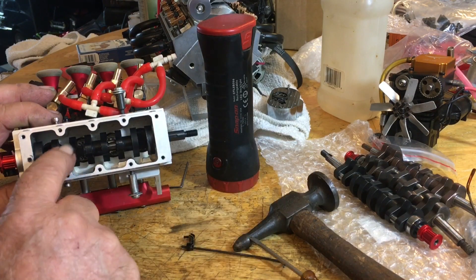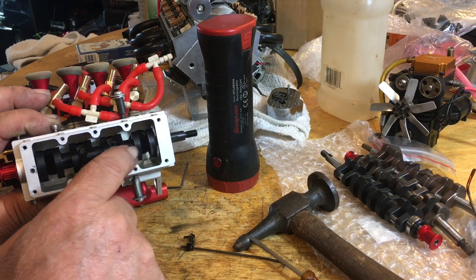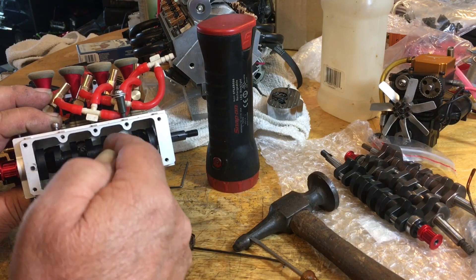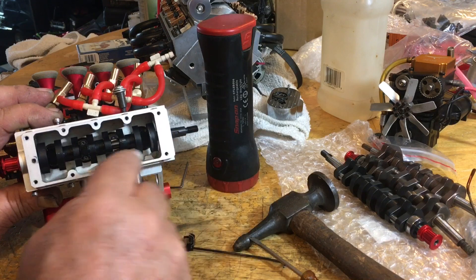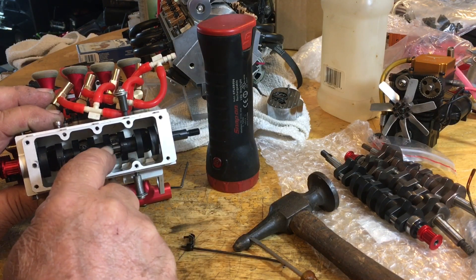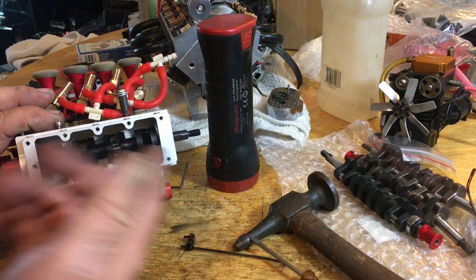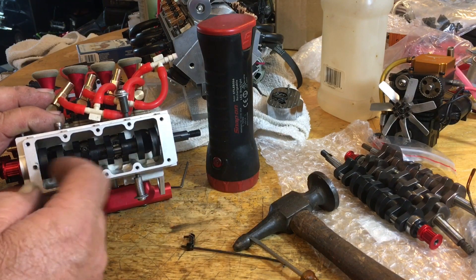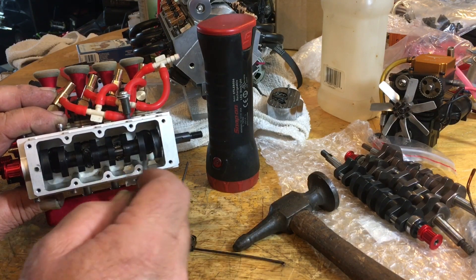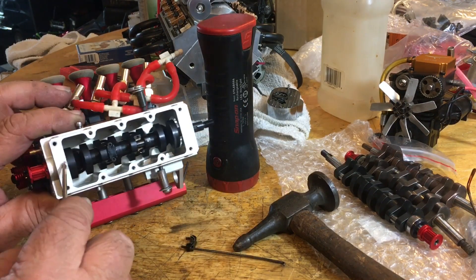The counterweight has openings — you've got the wide end and then the narrow end. You want the narrow end to come through just on the edges of all the rods in the block. When you get to number three as the crank is coming in, this rod has to be down. Turn that rod just to the side, slip it by, then use a screwdriver or an allen wrench to make sure all the rods are free, and then slightly tap the crank forward into the front seal.